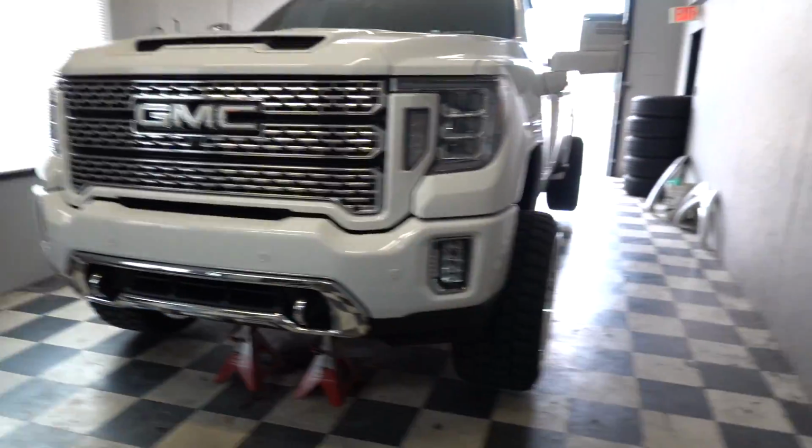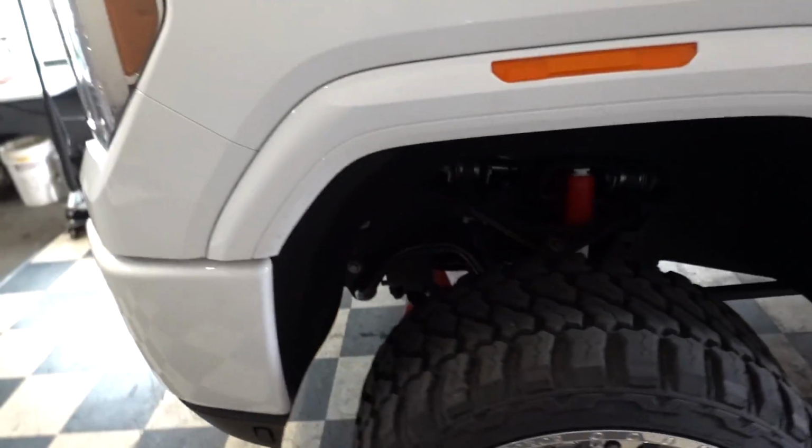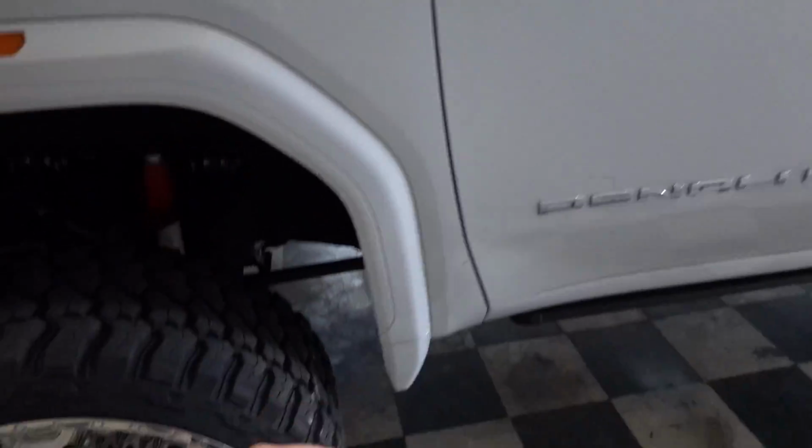All right, guys, so this is the deal. My tires are all screwed up because I didn't do one thing, like an idiot, but it was kind of intentional idioticism. Is idioticism a word? If it is, great. If it isn't, fine. I don't care. But basically, my tires look the way that they do, obviously, they're mounted on the truck right now, because I didn't get an alignment when I decided to crank in the torsion keys to push down the geometries of the front end to clear the bigger wheel and tire setup without having to cut my bumper or my cab.